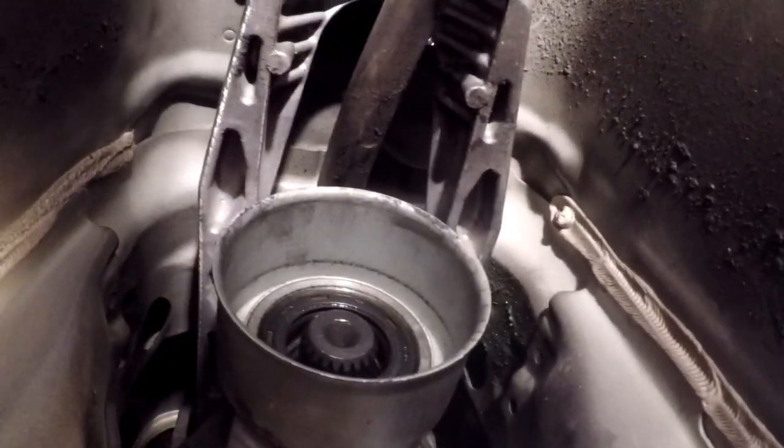We have this ground wire that goes on the starter bracket up here, and we're going to go on top of the car. We have this connector that's going to go back on the starter, and the power wire that goes on the starter, and then there's the 2 plugs on the top of the transmission and the clutch push rod actuator that needs bolted back down. So we're going to button everything up top there, and then we're going to come back here. We're going to put the drive line in and get that remounted back up in here the way it's supposed to be, which includes our center bearing here. And then we can start looking at filling this baby up with some nice fresh fluid.